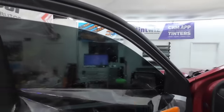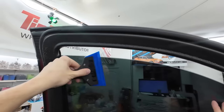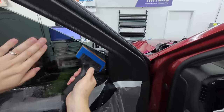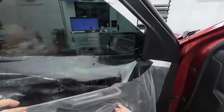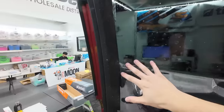Run your finger over the top, make sure you're not going over — if you push it up a little too high, shift it down. Get below that top edge; if those corners hooked up at all, drop the pattern down even farther. You don't want that — keep it as close as you can. For installation, one squeegee can work for both cleaning and installing; you'll just wear the blade out a little faster. You can switch between different squeegee blades and get the exact same result.